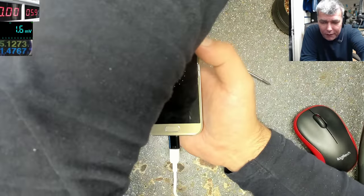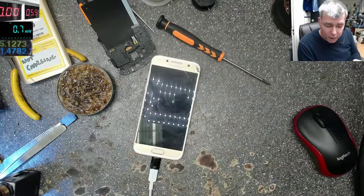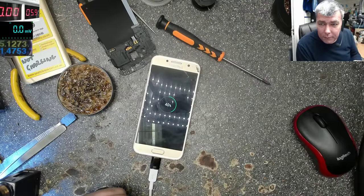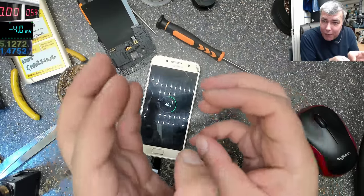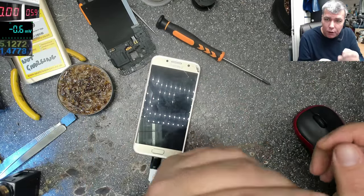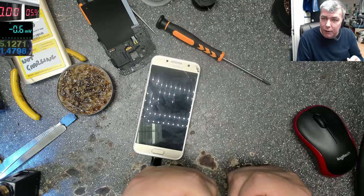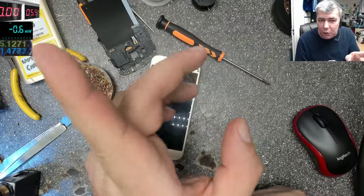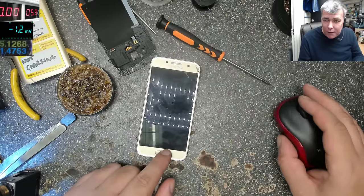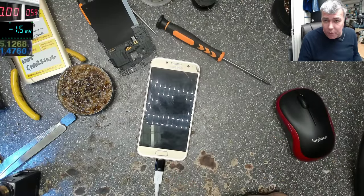It's not a big thing but it can happen. If you want to fix only the charging — that's how. If you want to fix everything, you have to bridge each pin. It's just bad design — that's why the traces get broken. Charging fine. The must-have pins are not only plus and minus and shorted data, exactly like micro USB — plus, minus, and short the data pins. The data pins when charging actually set up the charging current. Thank you for watching, like and subscribe if you liked the video, and see you on the next one — just a short one, bye.